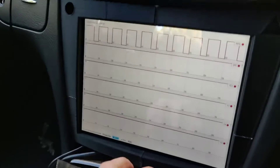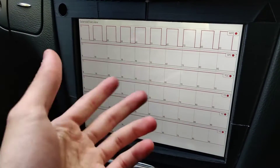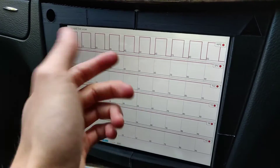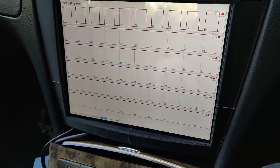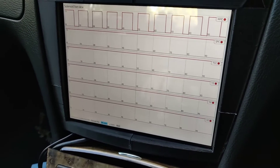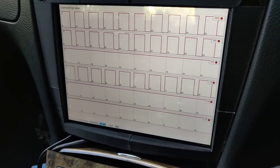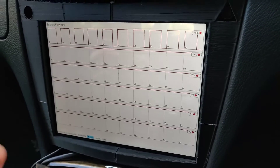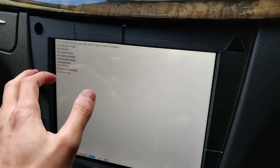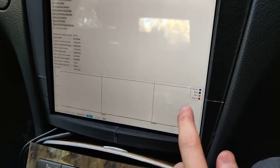As you can see, I've currently got my TCU app on here. This shows the solenoid positions — I'll shift into reverse. This is basically like an oscilloscope: when each solenoid is showing low it means it's on, high means it's off, because it's low-side driven. I can go to neutral, go to drive, switch to first gear. This is really useful for the TCU development, because it means as I'm driving I have a really obvious in-my-face display of what's going on. I can do stuff like diagnostics and view live CAN data — what the car is trying to do.